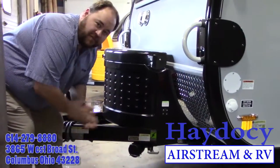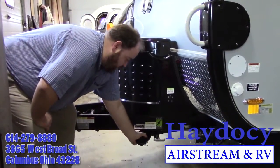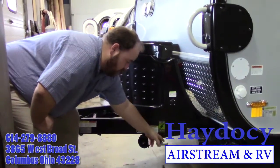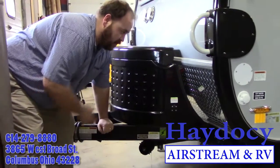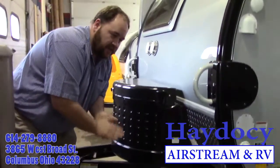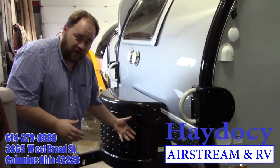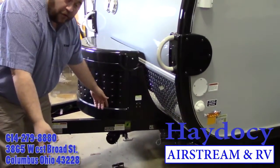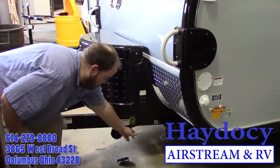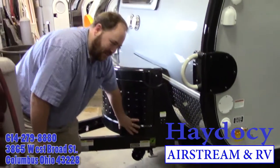The water systems are pretty simple. They're just like any other water system. You undo the caps and pull the lever, everything comes out gravity fed. There won't be any kind of clean outs or any of that kind of stuff you'll need to do to it. Pretty much all you want to do is just make sure your hose is hooked up properly. The hose is into the dump station or to the hook up there at the campsite. Pull your lever, whatever's in there will come out pretty quick, so make sure your hoses are hooked up.